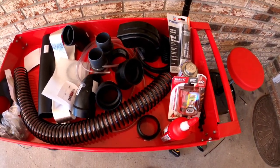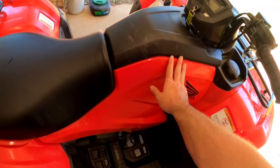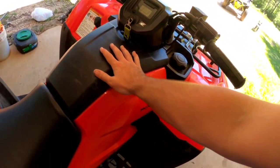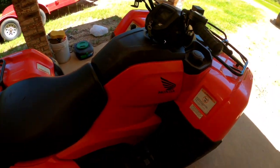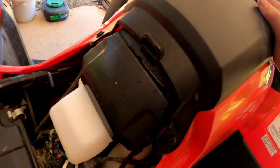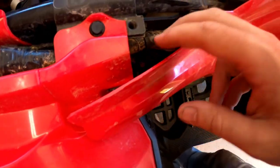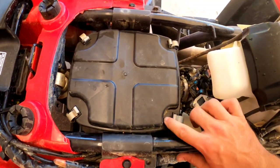The first step is taking the seat off, then popping these plastics off - they're pretty much just pop-riveted in there, you just kind of pull on them and they'll come off on each side. They say to take this plastic off over here as well - it pops off too. It does have push rivets right here beside the gas tank. You can take them off or you don't have to - they're connected to the side plastics. All this stuff just pops off with those little clips - you pull them straight out.